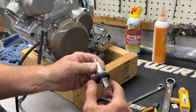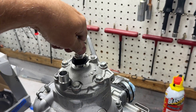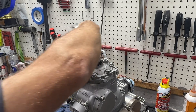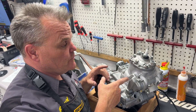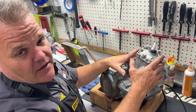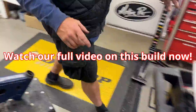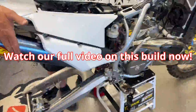I cleaned up the stock rubber boot that sits on the spark plug — the old one was looking pretty old, so we'll put a brand new one in. Good time to do it when you do the top end. If everything's running good, we hardly ever have to change these on carbureted bikes. On the TPI and TBI bikes we have had issues where we've had to. Pro-X piston change — pretty simple. In the bike you don't have to take the engine out to work on it, but it's nice that we have a clean engine to work on. This is a 2019 — the bike only had 60 hours on it. We're going to get this back in our chassis. Check out our other videos on this TX300 build — it's a bike we're going to have for a long time. The last of the Mohicans — the unicorn TX300, last of the carbureted bikes. Really cool bike. We'll have more videos coming.